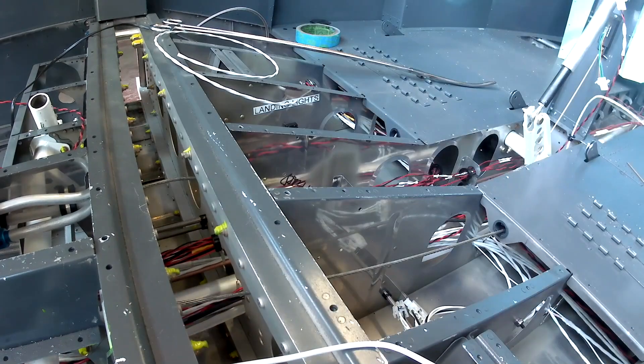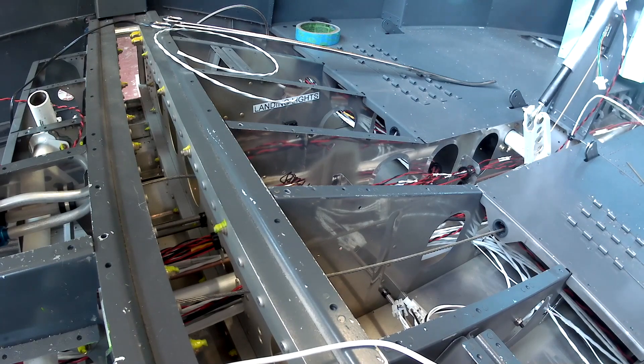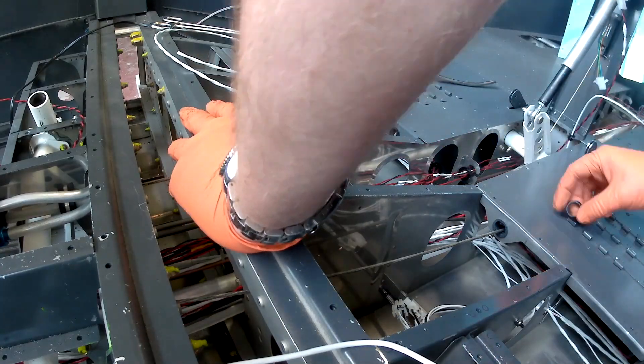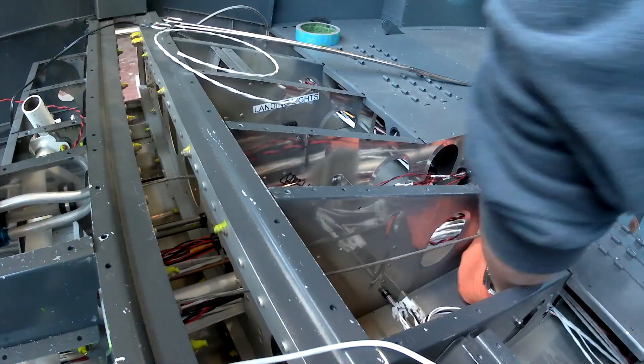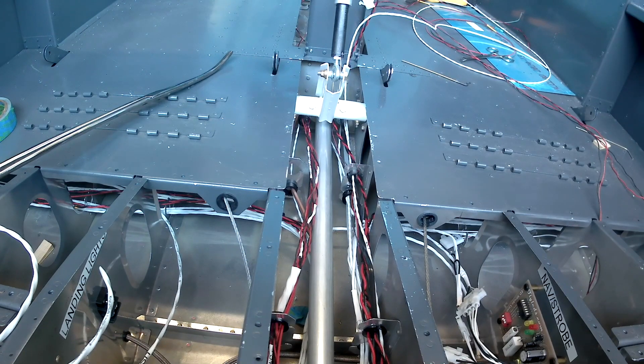There are other things besides just data and power. In my case I've got five pieces of coax cable running to the back. Each side has a com, the right side has the transponder, and I ran the GPS antenna and the WAAS antenna down the left side. You also have the static lines coming from the back — there's a lot of stuff. By the time you have all of that in, the bottom channel on one side wound up being full — there's not anything else that's going to fit. If that happens and you need to add more wires, it's perfectly okay to add them to the top channel, as you'll see later. You can actually see it now — if you look on the right side in the top bushings, there's a white wire that shouldn't be there; that's the ELT. We'll talk about that later.